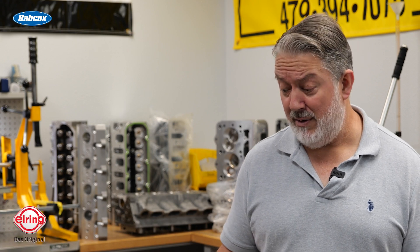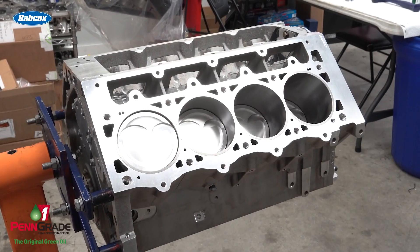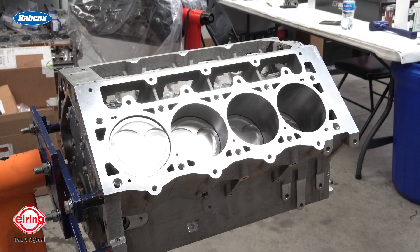The valvetrain — Billy Godbolt at Comp helped us. It's got some really modern lobes, about 850 lift. It has old Toyota cup springs for the valve springs from Joe Hornick at JHE, and some from ECR Childress Technologies. These motors with those heads can make over a thousand horsepower pretty easily. In a drag race format, you could make over 1,100.